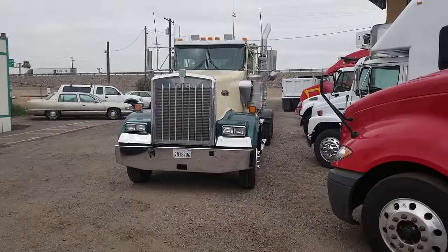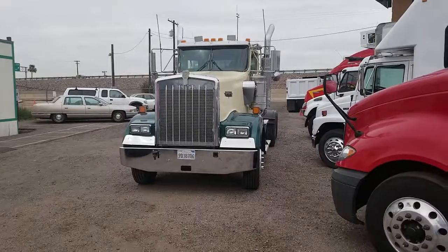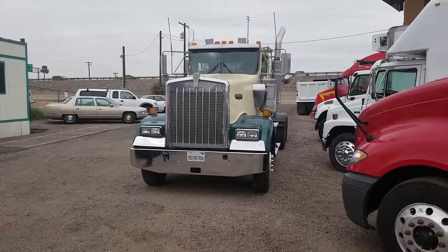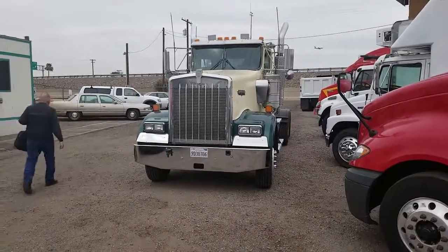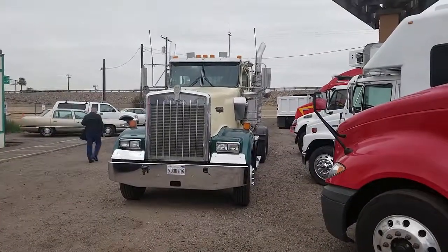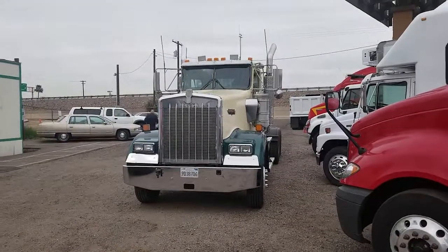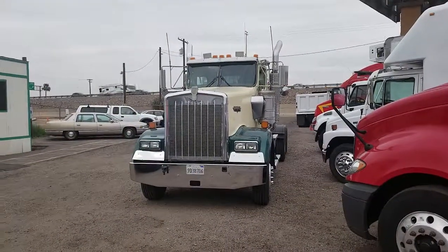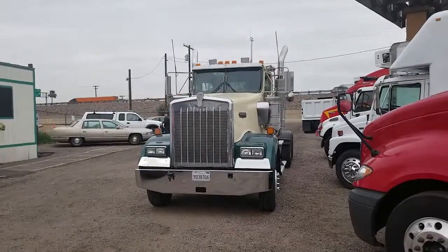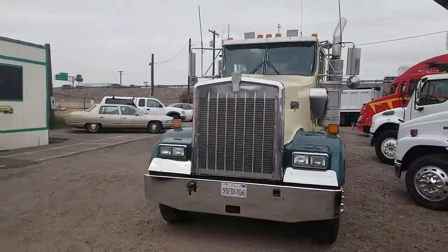Okay, Gary, here's the truck. We drove it back from Sacramento yesterday. It's a 475 6NZ Cat C15, 18 speed, 390 ratio, a little over 800,000 on the miles, 13.3 front, 40 rears, wet kit, 230 wheelbase, and Kozad ram. And here's what she looks like. Ran great.